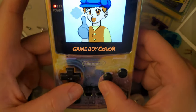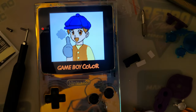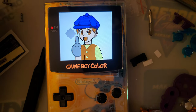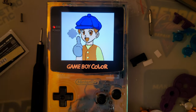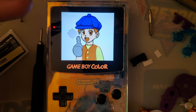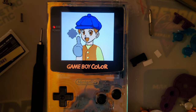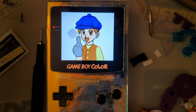Shadow sprite. So this is the interesting one. For this test, I'm usually running Legend of Zelda Link's Awakening, and I'm talking about that guy's chain, and here's that spiel again. The original Game Boy console did not have a way to achieve transparency with the sprites, and the screens also had a really terrible pixel response time. So one workaround most devs came up with was just to strobe the sprite, and because of the horrifying pixel response, it'll look transparent.